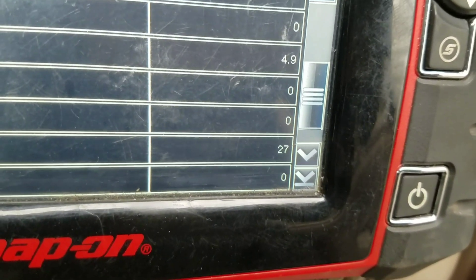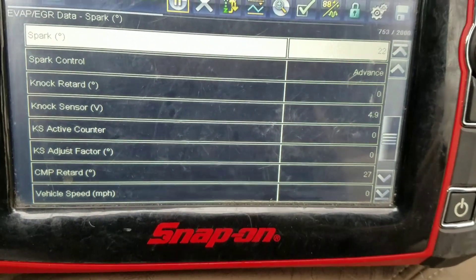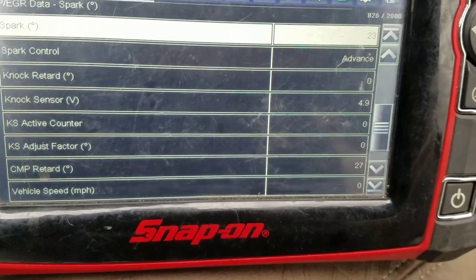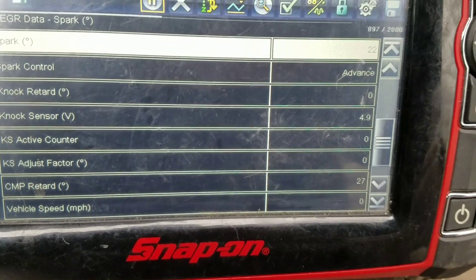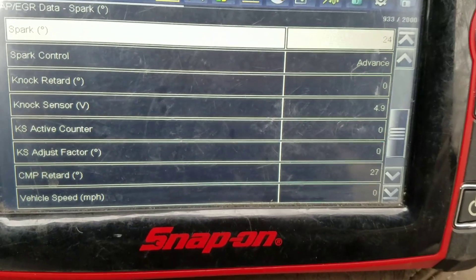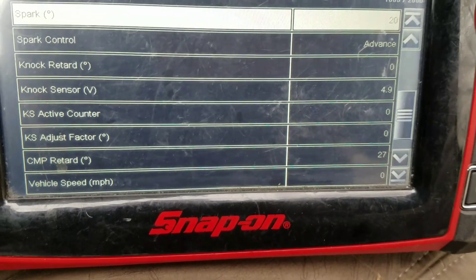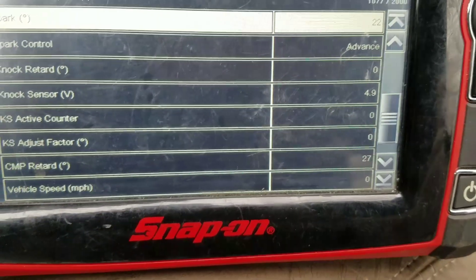So I need to turn it back a little bit. I'll go back out there, turn it a little bit, give it a quick rev, see where it comes back at, and go from there. You just want to keep adjusting it back and forth until you get it to plus or minus two degrees and you'll be good to go. Make sure you rev it up over a thousand RPMs to get a new reading every time you move the distributor. Until next time, thanks for watching.